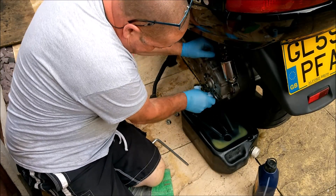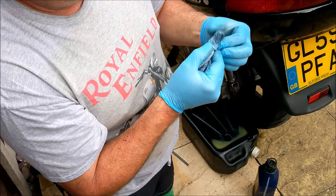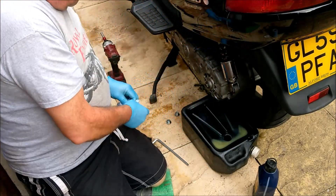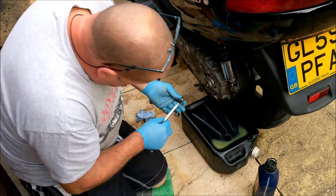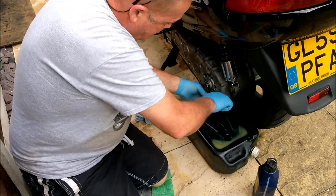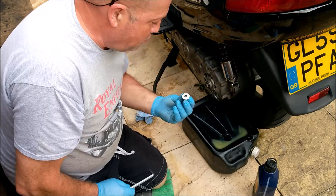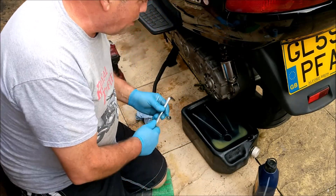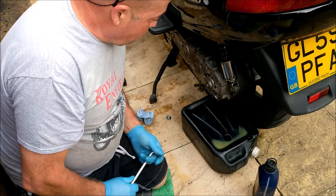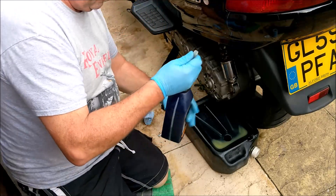Let's make a bogey rag to go in there, get right in there. Unfortunately there's a gear right there - when you look through the hole you just see teeth. I did this yesterday with an old rag and it came out like lard. So okay, I think that's got to be the end of it. Right, let's put this magnetic one back in - in the drain hole. Incidentally these 8mm Allen bolts - that one's absolutely murdered. Someone's had a go at trying to get that out using a cheap tool or the wrong size. So there we go - let's get some more oil in there, another 300ml.